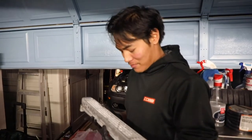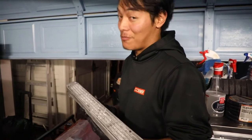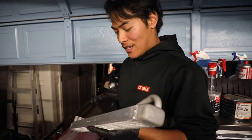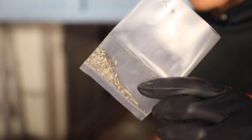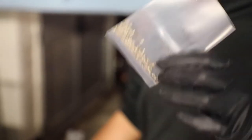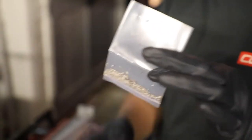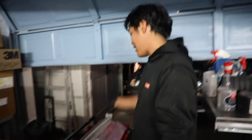We got the oil cooler back and it's looking really nice. This little shop we kind of sourced the work for just finished up the last oil cooler they're ever doing on an automotive application, so we got really lucky. But considering this thing is 2003 — 16 years old — this is the original oil cooler. It doesn't have any leaks, but it was beginning to show very high oil temperatures. And this is probably the reason why. This was a packet they gave us after they went ahead and cleaned the oil cooler. Some of it is material like rocks that were on the outside, but some of this was also inside the oil cooler as well. They had to flush it out three times because it was so gummed up inside that stuff just kept coming right out.